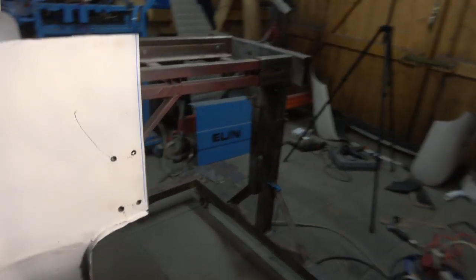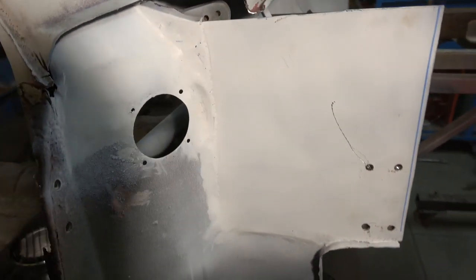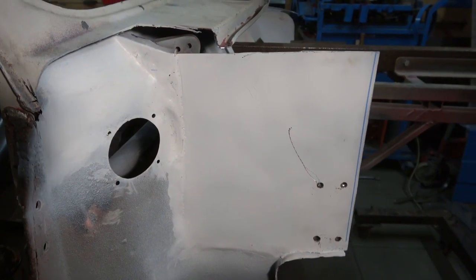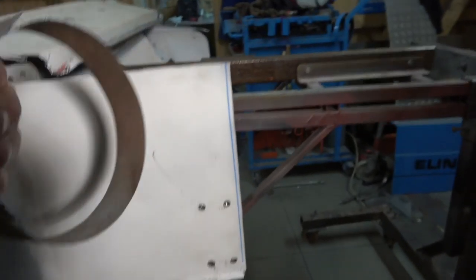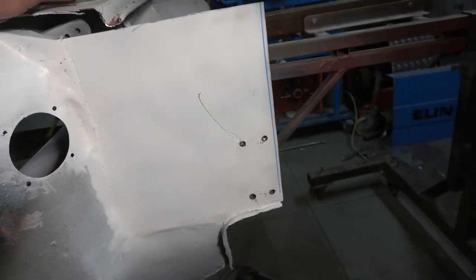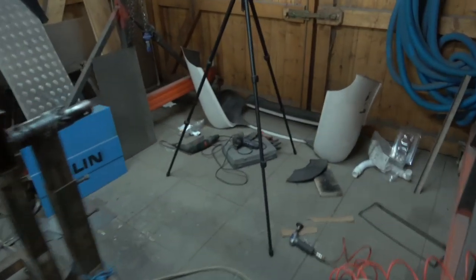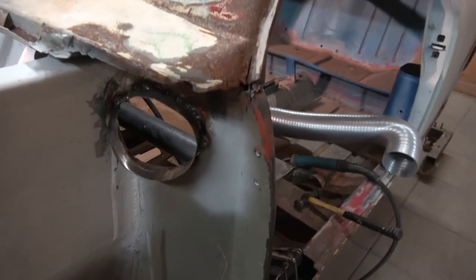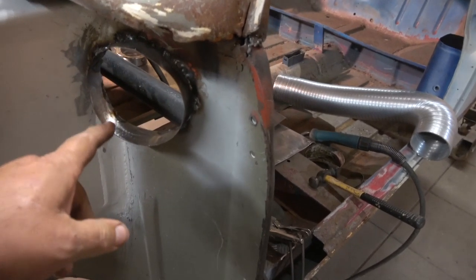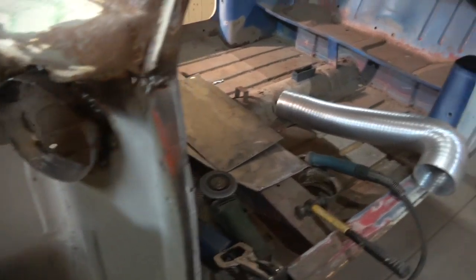This is the original opening for the ball vents in the car. What I'm doing is cutting these out to the same size as the pipe, and then making a ring from steel to go in there. I'll take you around the other side to show you one I've already started - you can see I've cut it out, with the ring facing forward because there's not much room in the back and it needs to go around the corner.